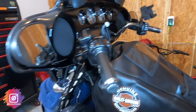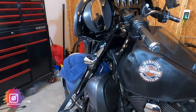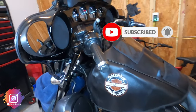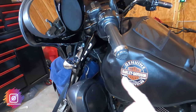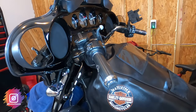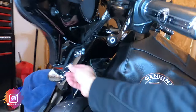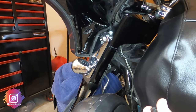We're going to have to take off the fairing. As you can see, I got some protective cover for my tank and I put a towel on my fender — something to consider when you're getting ready to work on your bike. On each side of the inner fairing you have two bolts, four total, and that's a T27.